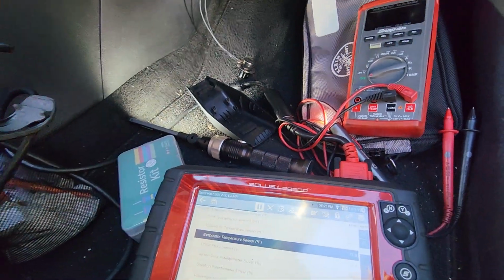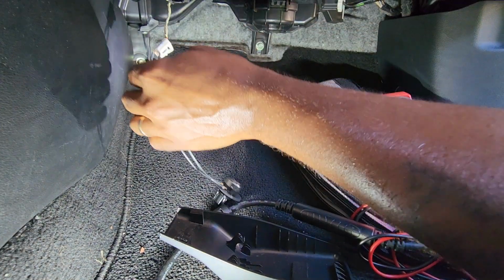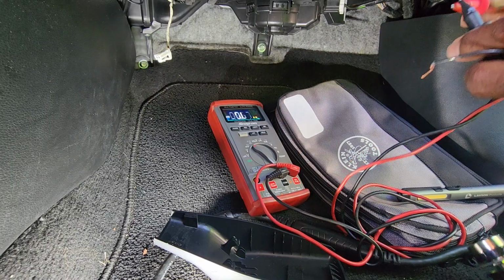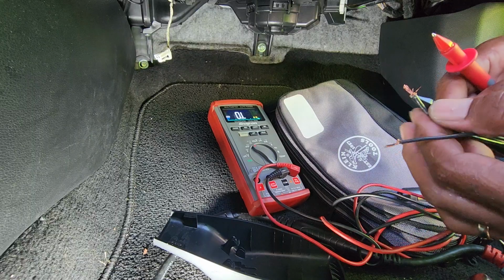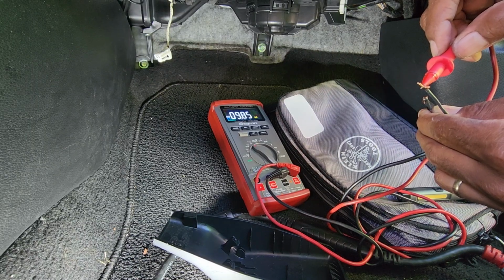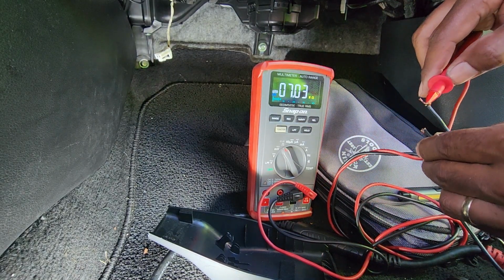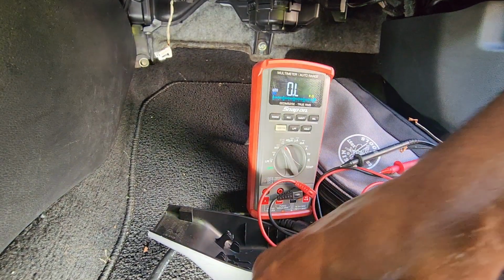And so let me pull that off and see what we're reading there. Pop this off. We'll get the multimeter put on ohms. It's open. So I got to just zero it out. And now let's go here and there, and we have 9.85 thousand ohms. See that? Let's do it again. 9.85 thousand. So a 10,000 ohm resistor. 10,000 ohm resistor should do it.